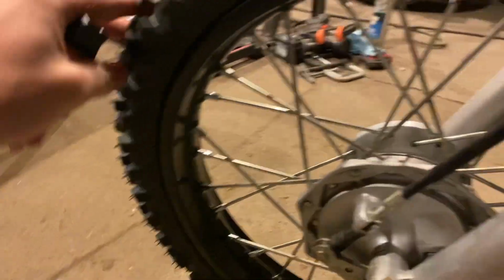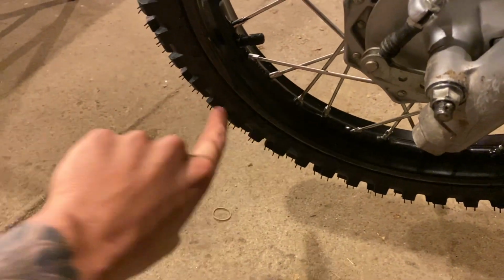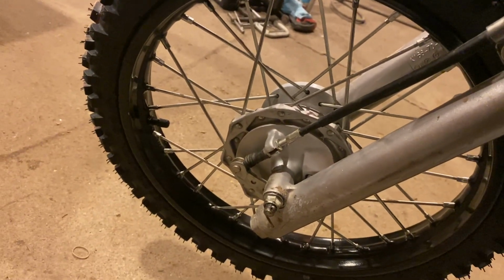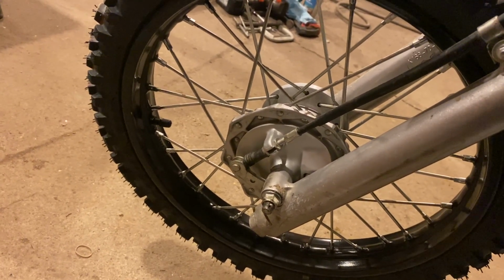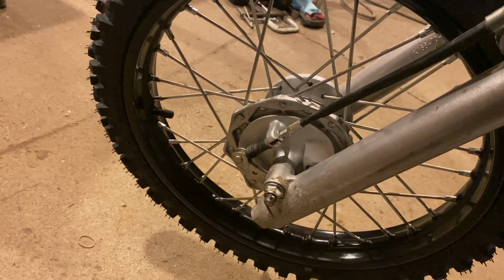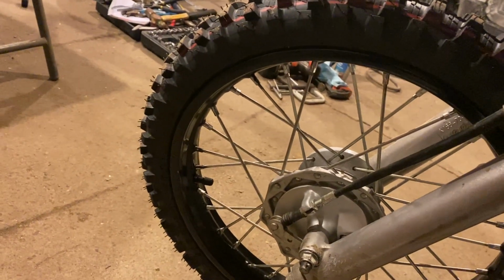The rims, I painted myself. I took a 220 grit sandpaper to the chrome and basically sanded it all down and in between the spokes as good as I could, and then hit it with a Scotch-Brite after that and smoothed it out. I did a coat of self-etching primer, and that's the most important thing, was the self-etching, because it gets into what you sanded up and all that. And then I did two coats of the black spray paint and maybe two or three coats of the protective clear coating. And that was for each front and back.